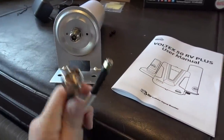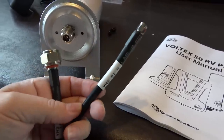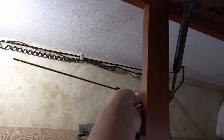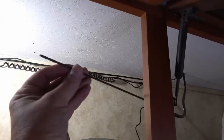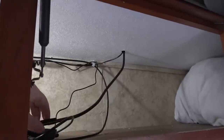Just to show you the connector — I'm pretty impressed with it. It's a nice big outside connector, weatherproof and everything, and this is the inside connector that connects to the amplifier. Looks like we have 20 feet of cable. For feeding the wire, I'm just using a one-eighth-inch super long drill bit — I can tape the wire on there. When I drilled through I had to go through a sub-roof, so there's about a gap that I had to get through. This is also great for drilling pilot holes and feeding wires slowly through.